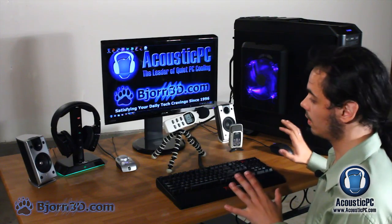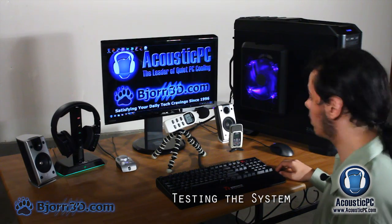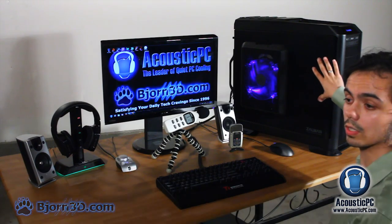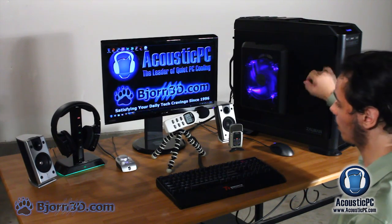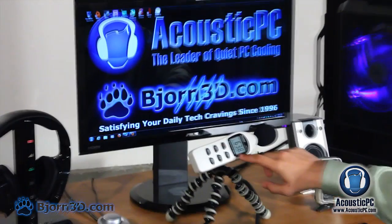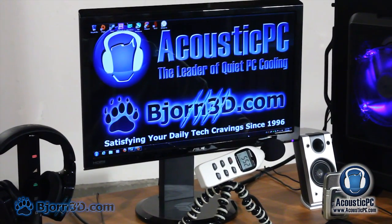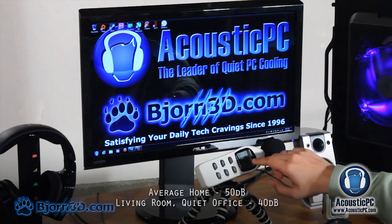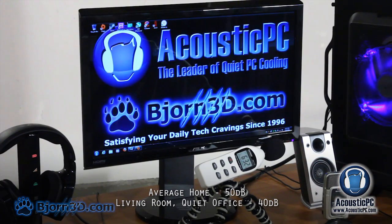Now let's get to testing the performance of our gaming system. For the purpose of testing, we have closed the lid in order to see what real acoustic levels we're getting out of this system. In order to measure the acoustic levels, we'll be using the sound level meter. Currently at idle, let's see, we're getting a reading of 43.3 decibels.